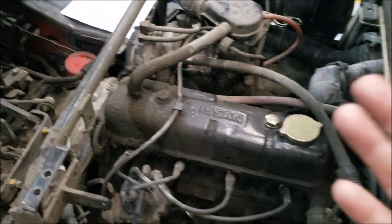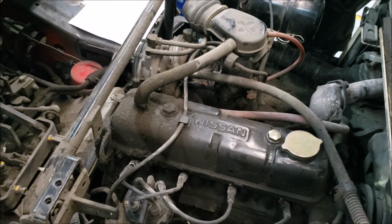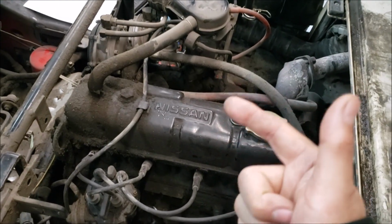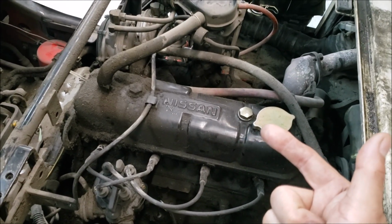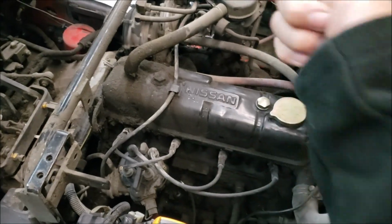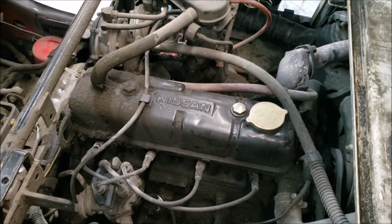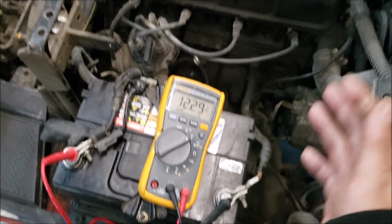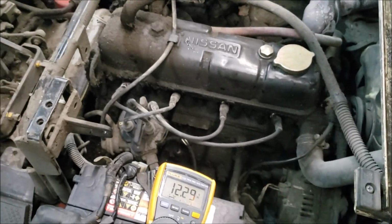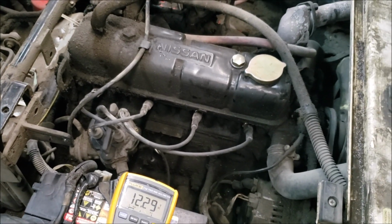And that's fine. So my problem with that diagnostic procedure is not the point that it may be a seized engine. This might as well be a seized engine. The problem with that is replacing the battery and replacing the starter before considering a seized engine. Okay? I get the battery. That's fine because the operator might have been cranking it, trying and trying. And if a used battery was in it already, which is more likely, it might have toasted the battery already. And that's fine.